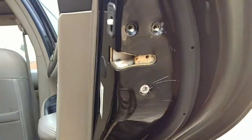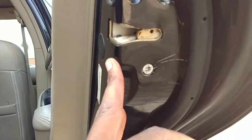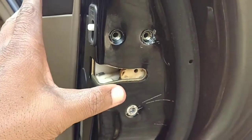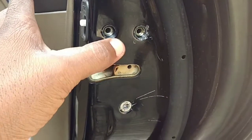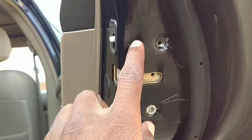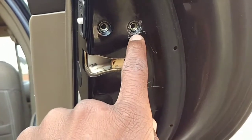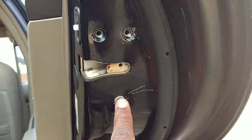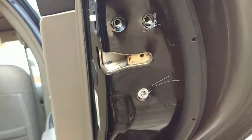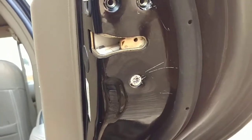I've been trying to take off the rear right door actuator in my vehicle because it's bad. To do that you need to take off the door lock assembly, and the screws are pretty much soft and have stripped. I was able to take some off with just a screwdriver, but a few refused to come off.